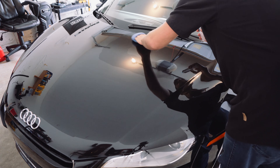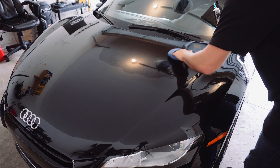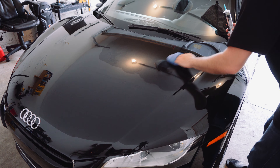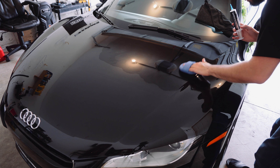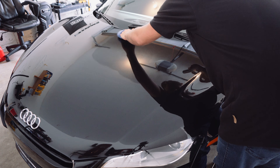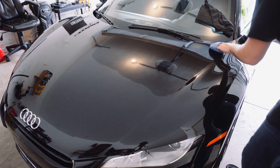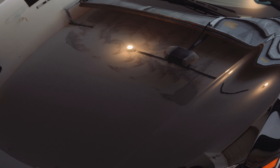Place your pad on the paint and massage and work that in. It kind of feels thick and you'll see it spread out really fast. Make sure you get full coverage over the panel you're working on. Some people like horizontal or vertical motions — I personally have no problem doing a circular motion because I know the paint is completely clean. Once the product is applied to the section, you'll notice right away an oil slick on water look starting to happen, and then it will eventually start flashing. You'll see the oil slick look start to disappear.